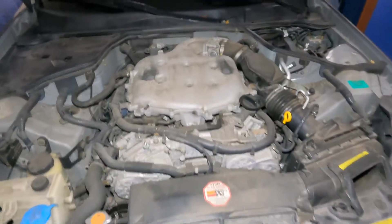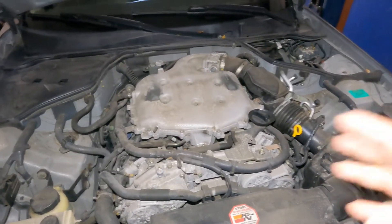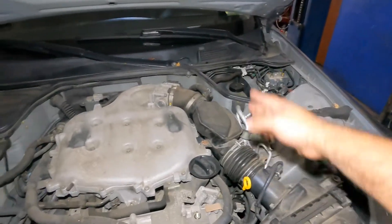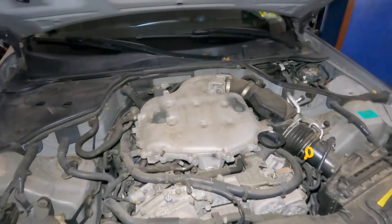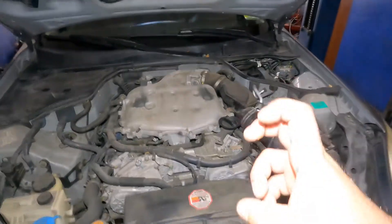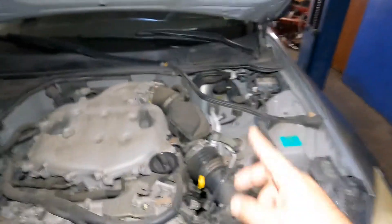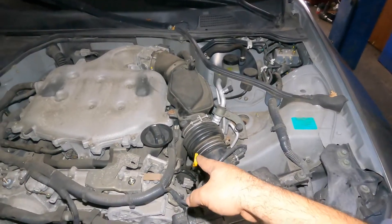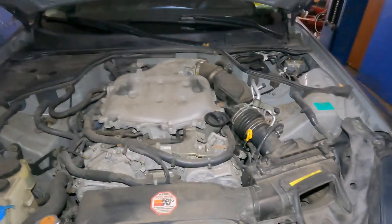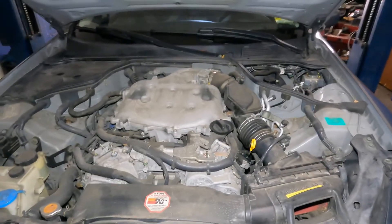It's a pretty tough job. I'll show you a little bit from my tune-up video — how I took this off. You take off this air duct housing right here, and on this side you just got to take a couple of ten millimeter bolts and make sure your connector goes in properly. So do change your spark plugs and coil. Let's say this coil is misfiring right here — number two — change the coil but also knock out the plugs. I would just do a tune-up every 60 to 70 thousand miles. We did a tune-up on this, it was at 70 thousand miles. Anyways, thank you for watching my video.